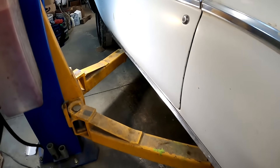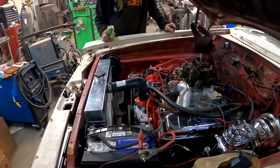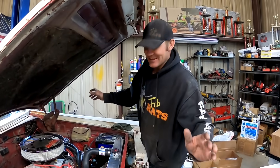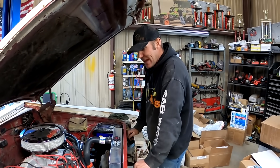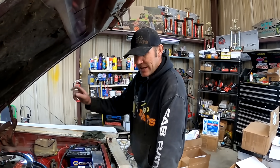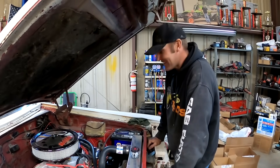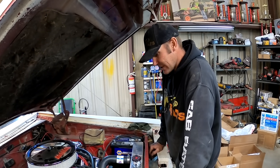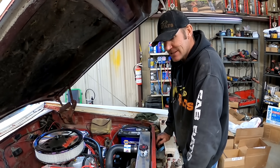Heater core — no good. Throttle, it doesn't want it. It's not done by any means, but we've kind of cleaned the shop out and can breathe for a minute. We broke the cam in — ran it for 20 minutes varying 2,000 to 3,000 RPM. I think she's good. We burned a header gasket up, gonna have to spend some money on some good copper ones. The heater core died — we're finding all the weak links in this car. But the motor sounds good, sounds healthy. We're gonna proceed on and keep putting this thing together for you guys — it's gonna be a fun ride. Thanks for watching.